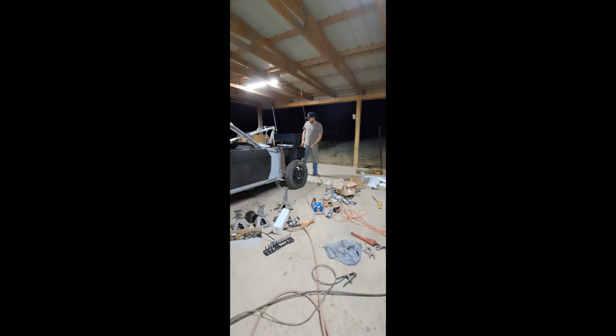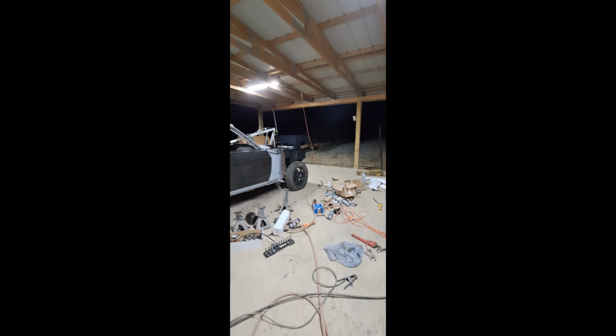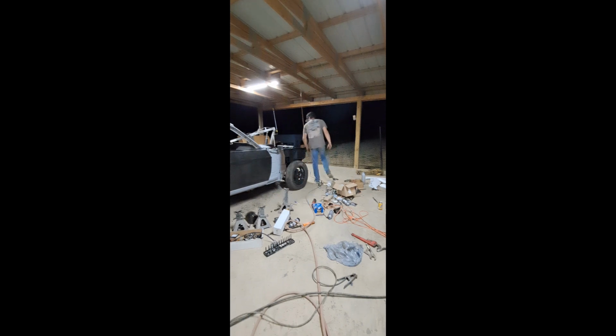Fan. I did a little cutting on this fan. I burnt my lower radiator hose. Fan just cut it. Like the engine just settled. Alright, let's try that again. I cut about 3/8 of an inch off of every fan blade on the very tip. I burnt my lower radiator hose. It's almost cut all the way through, so I'll have to replace that. It was all my antifreeze. Imagine that. That's what these tests are for. Oh, man. Hey, nuts.